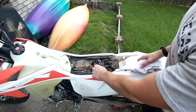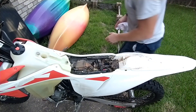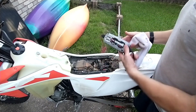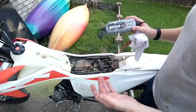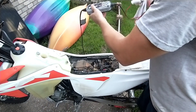So you're going to want to use a lithium-specific charger. You get a lot of mixed reviews out there about what to use to charge a lithium battery. If you use a normal battery tender, the desulfate cycle can cause damage to a lithium battery. It's just safer to grab a cheap NOCO or something that's got a lithium-specific cycle. You can also use some LiPo radio control car chargers — the super cheap Chinese ones work too.